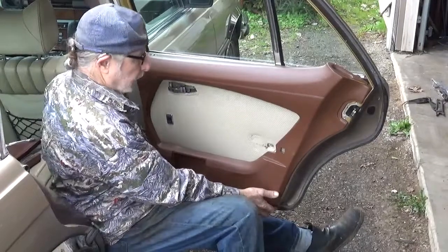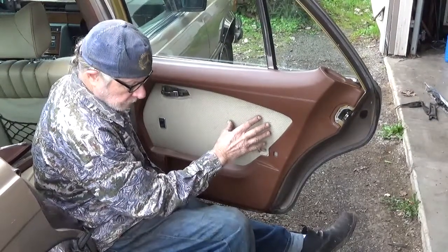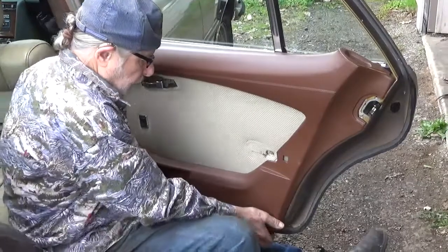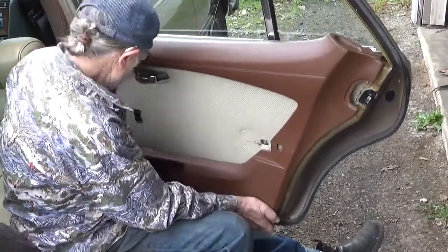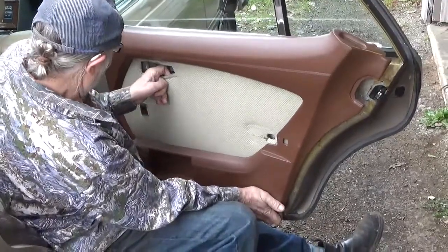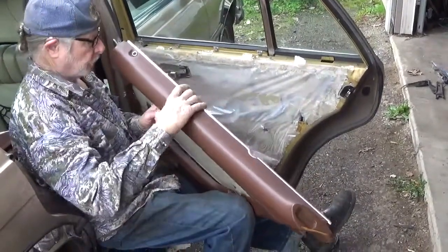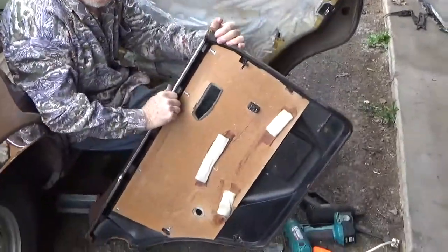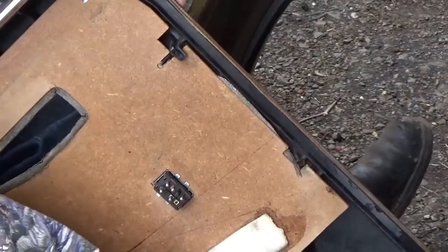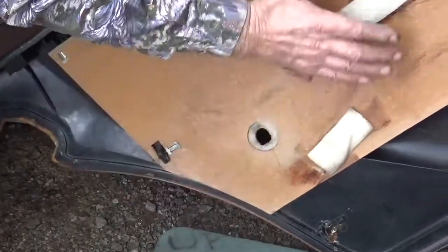We're ready now to remove the door panel. On 116 cars, 126 cars, and most of the later 80s cars, the process is different than earlier cars. On these cars you lift up the panel. This handle can keep you from lifting it all the way, so you need to pull the panel away from the handle. Then the handle comes up. You want to disconnect the window switch. There are hooks — somebody broke that one off, another one was broken and glued. That's why you lift it up.